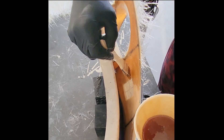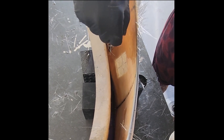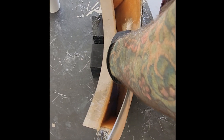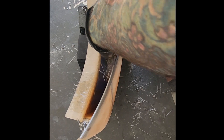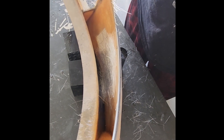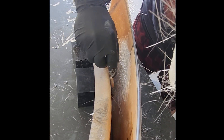Here I'm just working around the parking sensor cutout. I do not want to actually put anything in there because it is actually finished off on the inside. Here's a good example of me having to use larger sections of torn mat to put into place. You can see how I have to work the mat back down into the inside and actually kind of fold it over so that I can tie it back into the base panel — again, to keep everything watertight and make sure there's a good bond between the base panel and the new fiberglass.